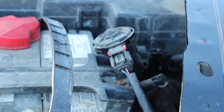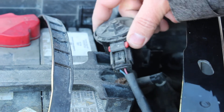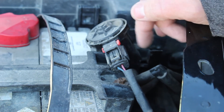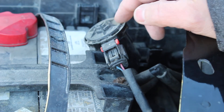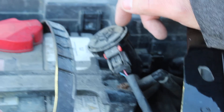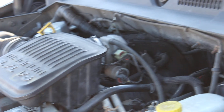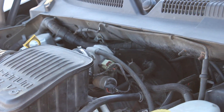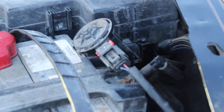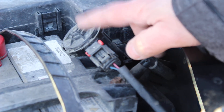Knowing what you know about air-fuel mixture — if this thing's leaking, once the charcoal canister's empty it's just going to be sucking air, adding air into your intake. That's unmetered air because it's not going past your mass airflow sensor. You now have unmetered air going into your intake by way of that hose up there that mounts to the silver part of the intake manifold. That's a system check that happens, and if that system faults for any reason, you'll get an engine light and a P0-something code. If it says something to do with purge valve, that's your component.